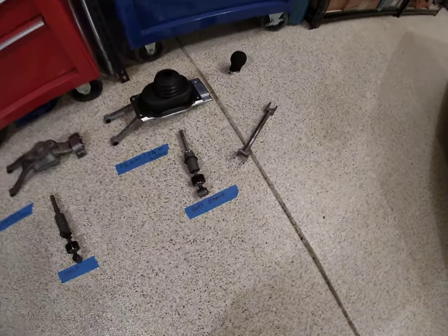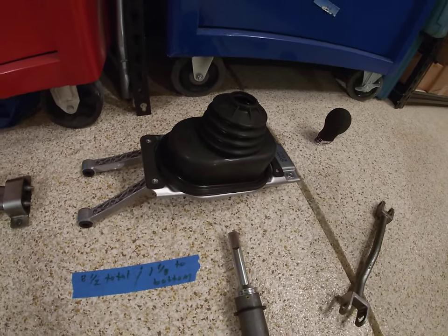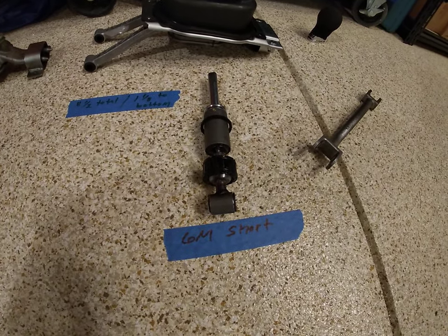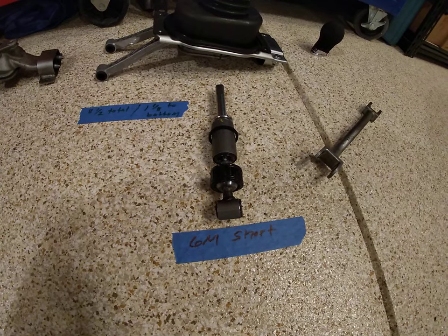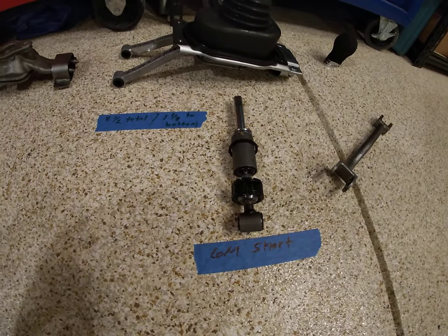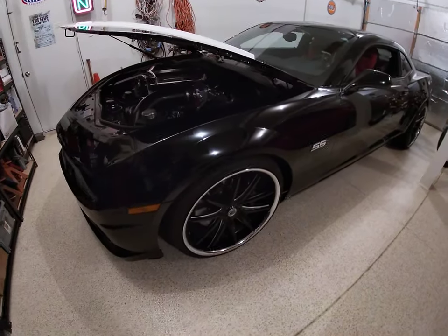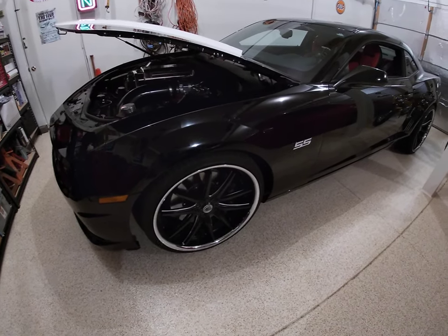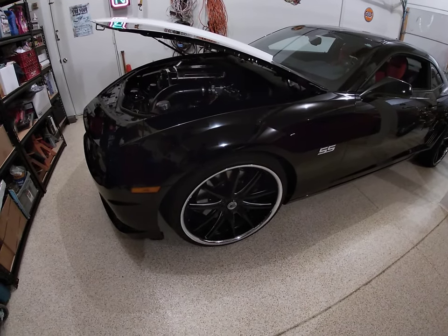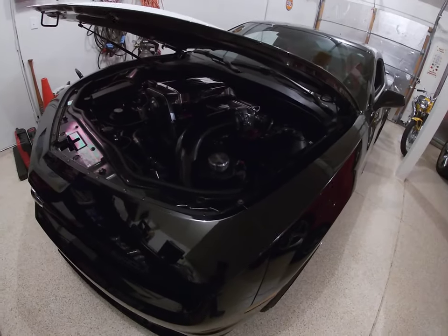How did this one feel in the car? I liked it, it had a mechanical feel and I didn't have any grinding issues with this particular shifter. But the thing I didn't like is it didn't have a real positive feel as far as what gear you're in. If you were at the drag strip in second gear trying to grab third, you're kind of like — well, I think I got third, maybe I grabbed first, maybe I got fifth. The bad news is you're going to mechanically over-rev that engine if you went from second back into first. The rev limiter is great under heavy load going into a higher gear, but you can mechanically over-rev it if you miss a gear and grab a lower one.